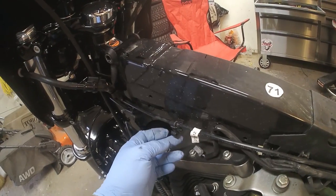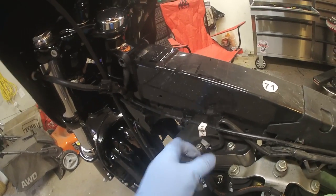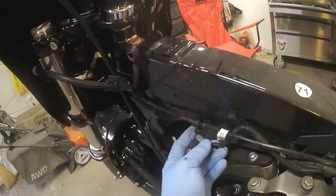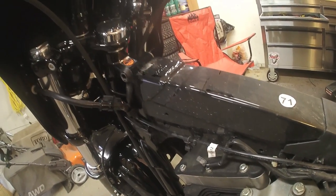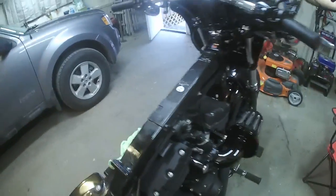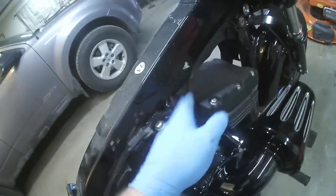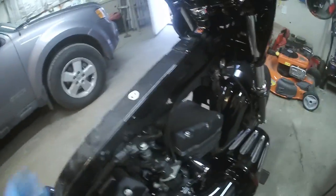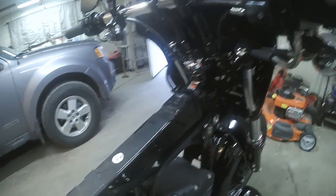This is that clip for the fuel sender — it'll plug in there and then hooks in there, and it's just a royal pain to get it with the tank on the bike. One removed fuel tank! So now you've got access to whatever you've got to do — if you've got to take your rocker covers off, do your throttle body stuff, or do your idle cables, it's all easy access. It took maybe a half hour with a smoke break to pop that off, so it's not bad at all.